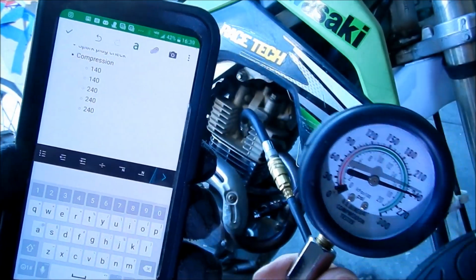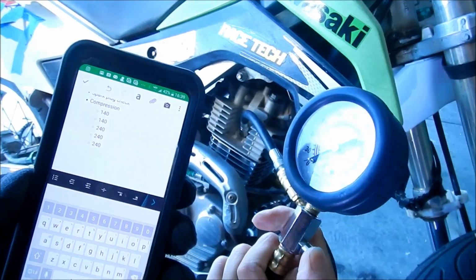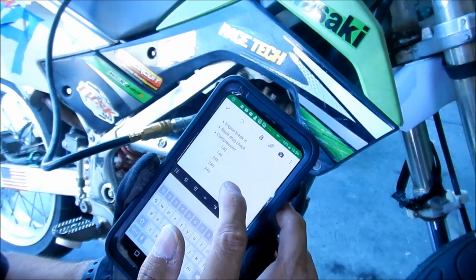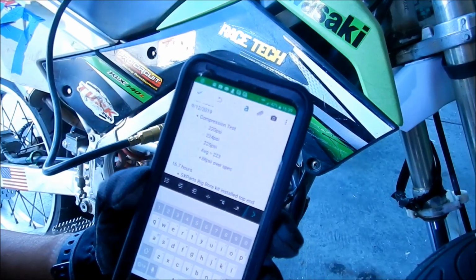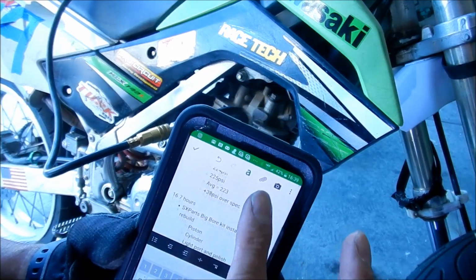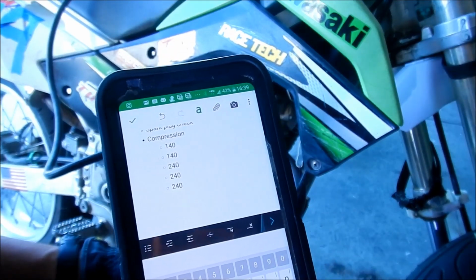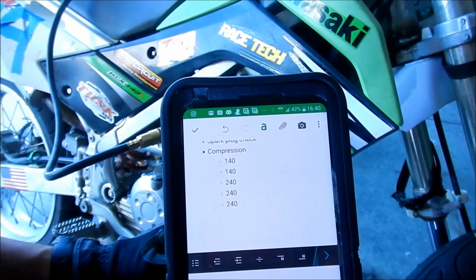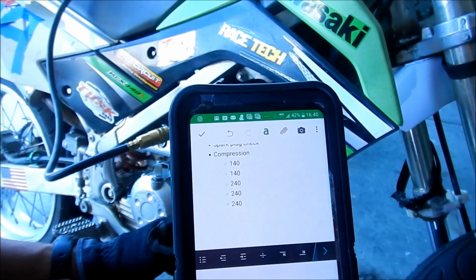Gee, boy, the difference holding the throttle open makes. That's a very healthy compression. That's really good. I'm gonna say we should put high octane in the engine. Well, it's only 20 psi more. Before we did the rebuild, we were getting 220, 223-ish. After, we're getting 240, and that's just right after break-in. It probably still needs a little more break-in, so it may go up some more. We'll probably check it after the race, is what I'm thinking. So 240 is what we're running.